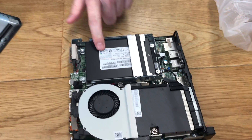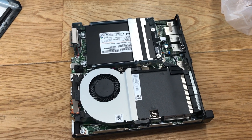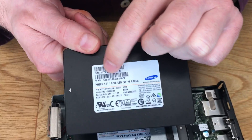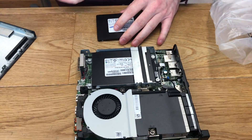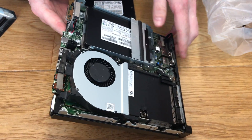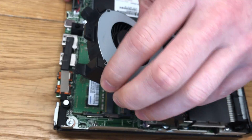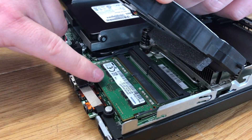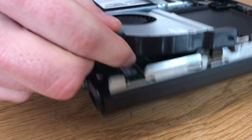There's a standard two-and-a-half inch hard drive in there. I'm going to take that out and put in this two terabyte SSD — so storage capacity has gone from 256GB up to two terabytes. The RAM is easy to get to as well; it's a DIMM slot. The fan just lifts up, so that's quite easy. There's a spare RAM slot, and it currently has an 8GB DDR4 stick, which is what you'd expect for Kaby Lake.